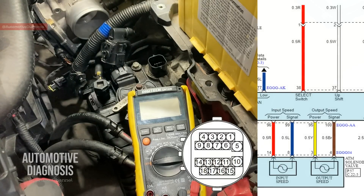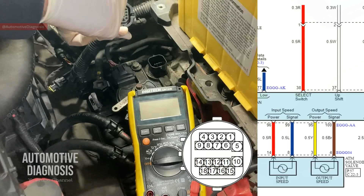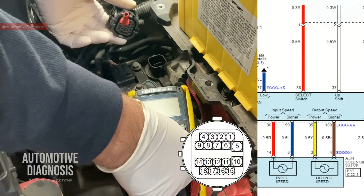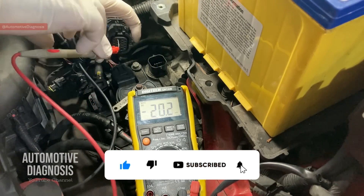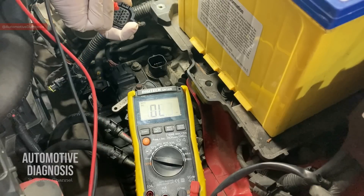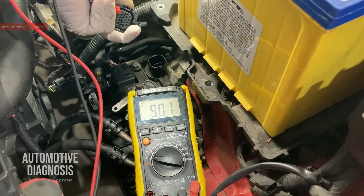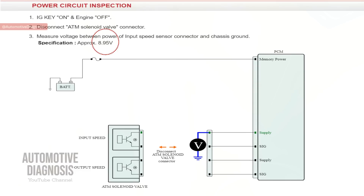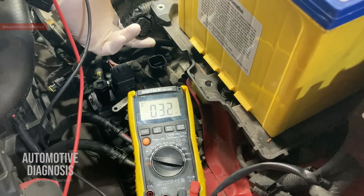So we're going to find pin number 14 right here. According to the connector guide, this is pin number 14. Put the multimeter on voltage and check the voltage between here and body ground. As you see, we are expecting something around nine volts when checking the input-speed sensor output voltage. This confirms the output voltage on the sensor is provided and there's nothing wrong. If it is not provided, you need to check the wiring all the way between here and the PCM.